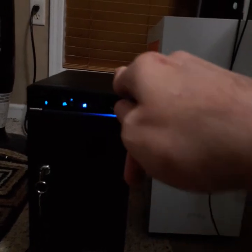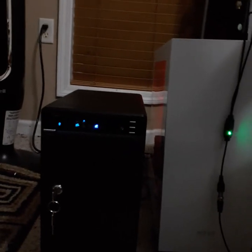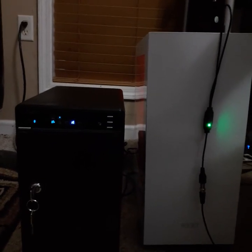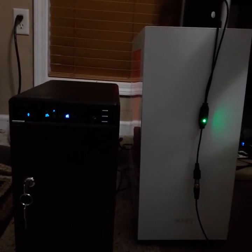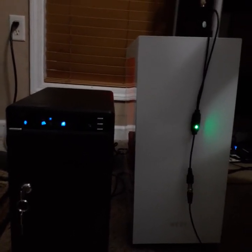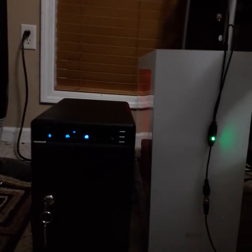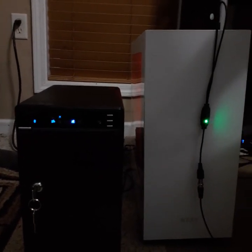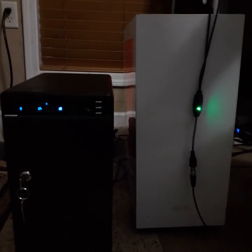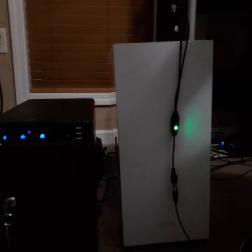There are 2 ways to connect. There's an eSATA port in the back, and there's also USB. In my case, I have it connected USB because I bought 2 PCI cards that are USB 3.0 ports. I did that because I prefer leaving the back panel there, because I have a lot of USB devices, including hubs, which are further behind there and offer more USB ports. And yes, in my case, the reason for doing this is for game storage or external file storage. As long as the unit's powered up, once I create those directories, it's fine.